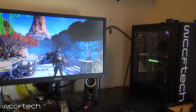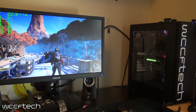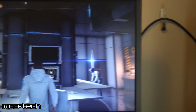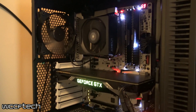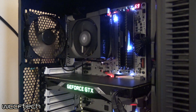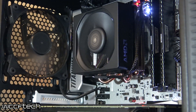Tests were run at stock settings — 3.6GHz base with a 4.1GHz theoretical XFR boost, which hardly ever happens with this motherboard. The overclocked test ran at 3.9GHz at a low 1.264 volts. It's important to note that this particular chip has been overclocked to around 4.025GHz at relatively low voltages, so 1.264V may not be typical of many other chips — this is just what was found with this sample.